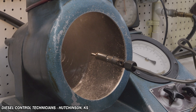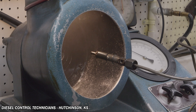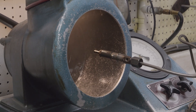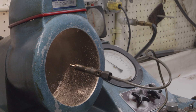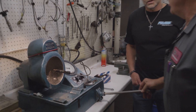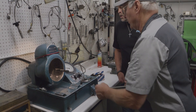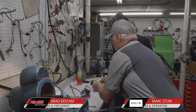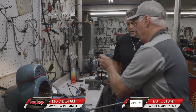It's a 5.9 Cummins nozzle assembly. What are you looking at here? Pressure — that's the pressure. But what are you looking for though? It's got a spec. It would have a spec in this. The spec is written right on here, written in bar — metric. 275 bar. That's what this should be. It's a new one so it's probably going to pop off at 280.